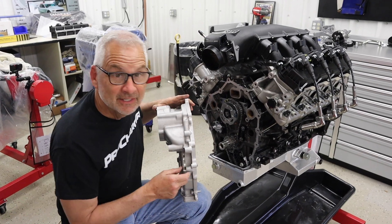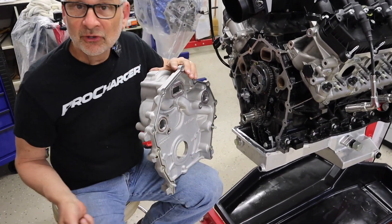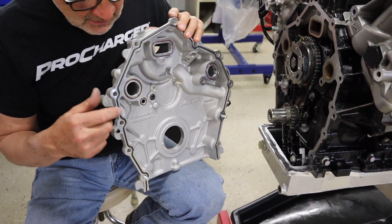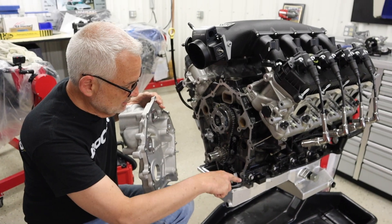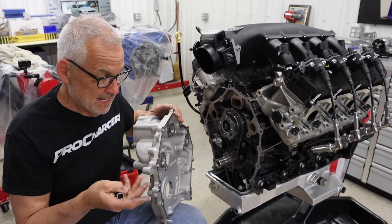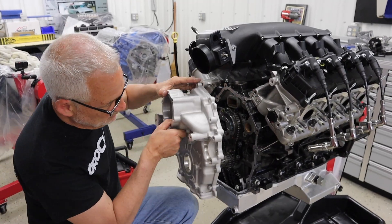The Holley has an O-ring groove around the entire perimeter, along with O-rings on both sides. One thing that's kind of hard to appreciate from here is how much narrower the Holley front cover is compared to the stock front cover, which was designed to fit the Super Duty so width wasn't a big deal. Looking at them side by side: Holley is much narrower, much more compact — and you'll really see that when we put the front accessory drive on. Also, the Holley already had the dowels installed, so I didn't have to search through the bag to find them. With the 4.17 Motorsport pan, we still need a small amount of RTV on the bottom lip, but nowhere near as bad as having RTV around everything.